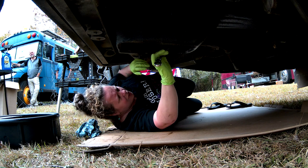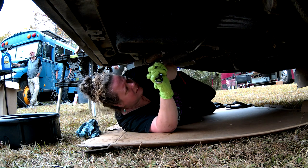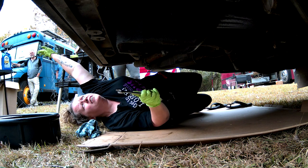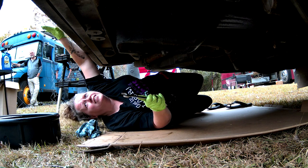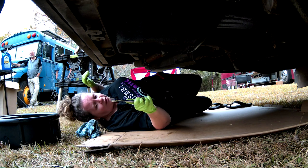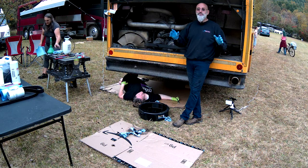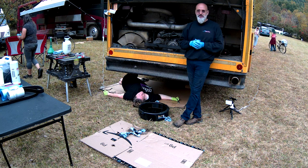So basically, after you've had one or two oil analyses done, if you change your oil at 5,000 miles and the analysis comes back saying your oil is basically new, then you know you can stretch it out a little further the next time. And if it comes back saying you've got no viscosity left, meaning the thickness of the oil, then, oops, I need to change it sooner next time.